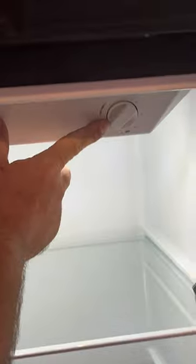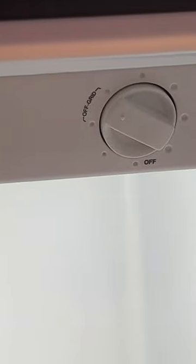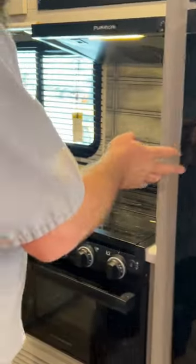As we come around, we're going to have our fridge area here, and it's a pretty nice size. It is a 12-volt style, and you're able to adjust it right here. The nice thing is with the solar panels, if you're doing some off-grid camping, you're able to turn this guy to these two notches — that's off-grid, so it won't be pulling as much power to try to stay cool. Usually on those hotter days, these guys do struggle to stay cool, so just please be mindful of that. And if you're going to turn it off so it wouldn't drain the battery, you're going to turn it all the way and you'll feel a click.